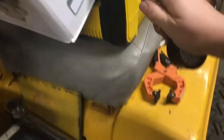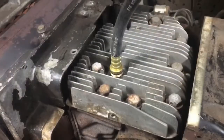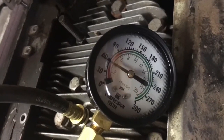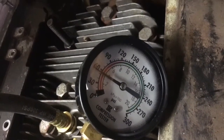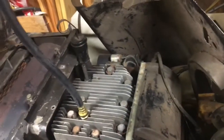Now that those are all torqued down, let's grab the compression tester. Before I did this, it was right around 90 PSI — let's see if that goes up. Make sure that's snug. Turn it over and let's see what it reads. We're only at about 58 PSI. However, I think the compression release is finally kicking in on it, which I think is good. As soon as it doesn't turn over like that, it struggles even more.